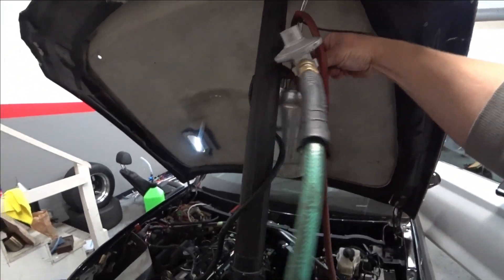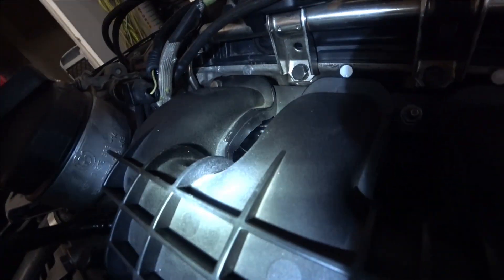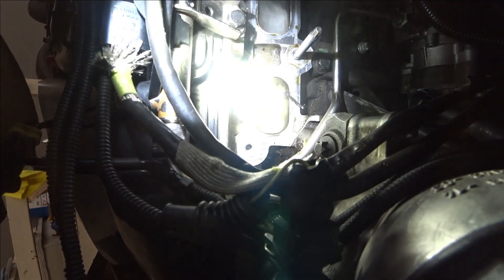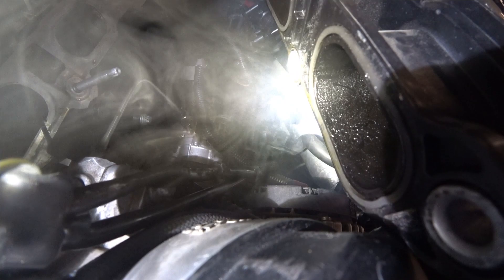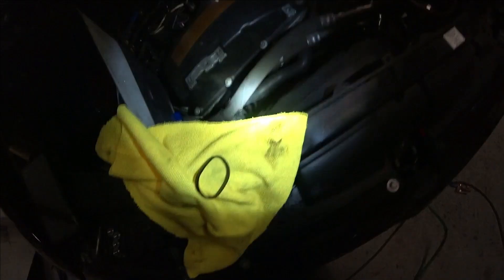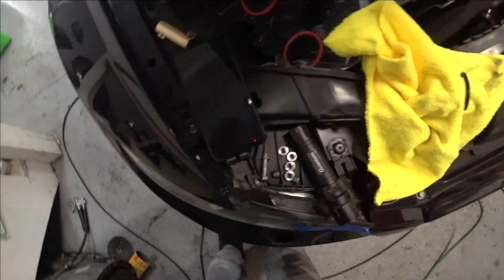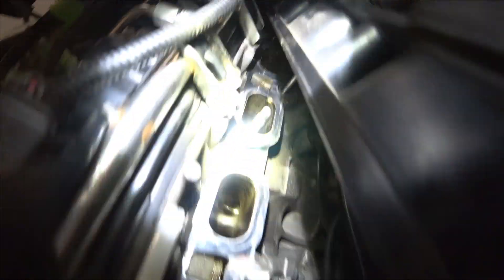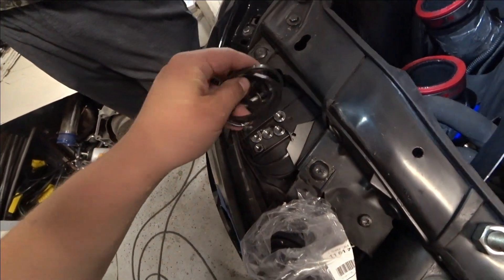Then you smoke test the car — and that's it. Guys, this is why you check for boost leaks. You see the plastic piece inside? It freaking jammed in there between the manifold, guys. This is why you check for boost leaks. Can you guys believe this? We're gonna go order the new rubbers right now just in case and change them all. The valves are so clean — it's methanol. All right guys, removing the old rubbers — they're kind of hard compared to the new ones.